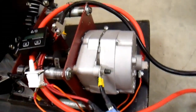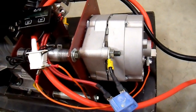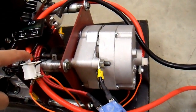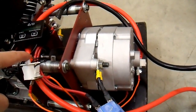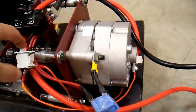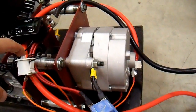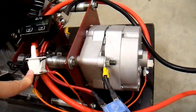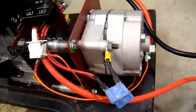It appears that this alternator from DB Electrical is some sort of hybrid — it's not a true 1-wire alternator, nor is it a true 3-wire alternator. On a standard Delco Remy 3-wire alternator, if you turn the switch on and keep it there, it will send full field current through the field windings and eventually burn it up if the engine isn't running and the fan's not turning. On this one, with the engine stopped, even with the button pressed in, it runs no current — or at least a very low amount — through the field windings. However, I have to hold the button in for it to run, even with the engine running. So I'll just change this to a toggle switch instead of a momentary switch, and we should be good to go. It does seem to generate; I haven't really tested it beyond that.